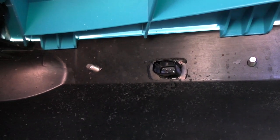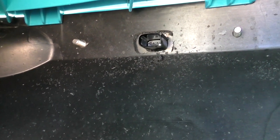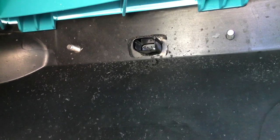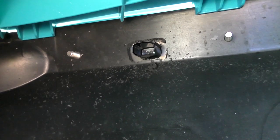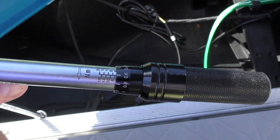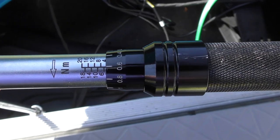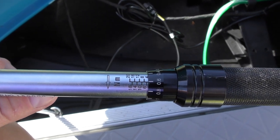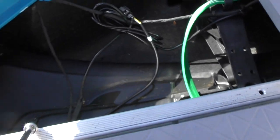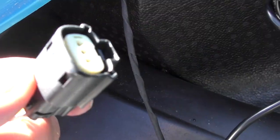Under the front you can see the two bolts coming through and the connector. We're going to tighten the bolts to four and a half Newton meters using a torque wrench, and then we're going to snap the connector in and that side will be done. I do use a torque wrench — this is one that's small enough to get down to four and a half Newton meters, since some of the larger ones won't torque that low. I'm getting ready to plug my cable in and I'm going to apply some dielectric grease to the inside so I can have a nice seal.